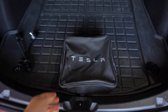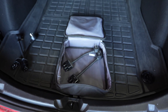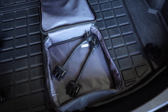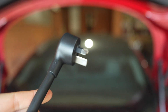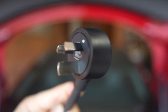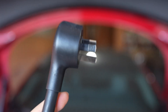Today we're talking about the pigtails or charging tails for the UMC, the universal mobile connector or mobile charger. Depending on the age of your Tesla, this may or may not have come with your car. I have a 2019 Model 3, so this mobile charger came with my car, along with two pigtails: a 10 amp one for regular household plugs here in Australia, and a 15 amp one more common at caravan parks or campsites. You can tell it's the 15 amp because the ground pin is quite a bit bigger.